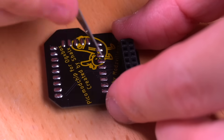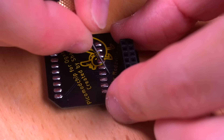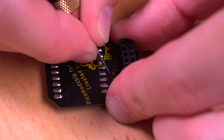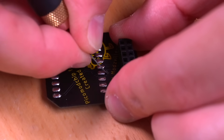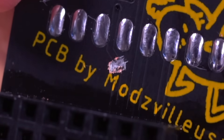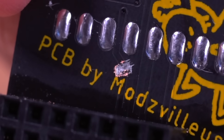This leaky cap was so corroded that one of its leads fell off. Turning attention back to the modchip — one thing I need to do is cut this trace here. I want to make clear that this is an older prototype board, and Modsville has loaded his newest revision to his GitHub, so you will not need to cut any traces.